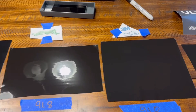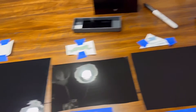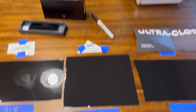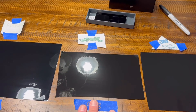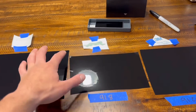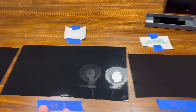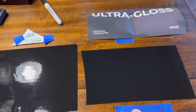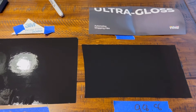Also take into consideration the difficulty of applying the films. The Vivids are the glossiest but will be the most difficult to apply, especially for a beginner. The Cheetah is probably one of the least expensive brands — getting closer to Vivid in price now — and it's a thinner material, so it's easier to apply. However, you can't stretch the Cheetah as much as a thicker film like the Vivid, which can stretch a lot more without changing the glossiness or color.